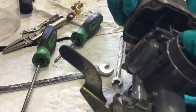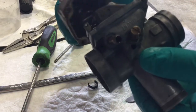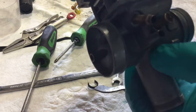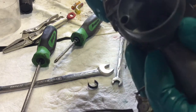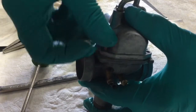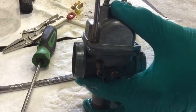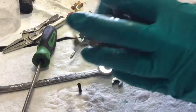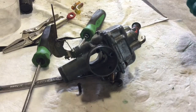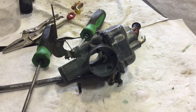Then you've got your bowl that you can just put on. There is a tube in there — a couple of tubes — that you've got to get lined up, so you don't want to force it. Just make sure the tubes get lined up and it clamps back in. The rest of the assembly is pretty straightforward. What I'm going to do is put this back together, then probably take the petcock out of the bike, drain the gas, clean up the screen and the petcock because it's pretty stiff, and oil it up. You wouldn't believe how well that works — just some penetrating oil in there and clean it, make sure it's not clogged up. I've got a new filter and fuel lines and I'm sure this thing is going to run like a top.